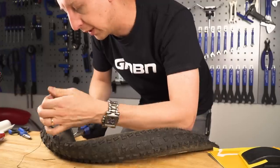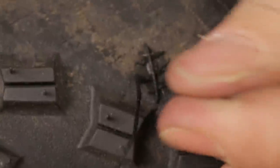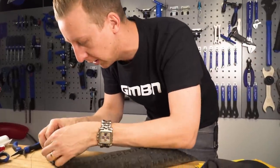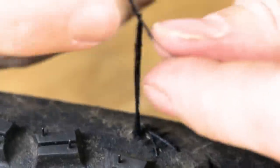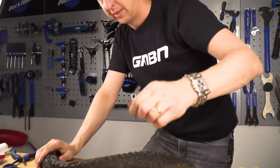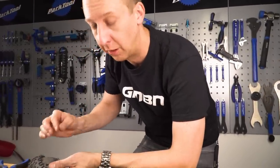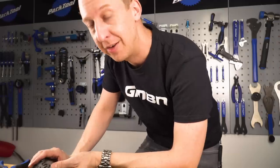I'm going to cover the stitches externally in another step later on just to make sure they don't come undone and the stitches themselves won't rot. That's a tyre knot in there and I'm happy that it's going to hold despite not looking like the best work. If there are any surgeons out there you'll probably be disgusted with this, but it's a tyre so I don't really care. So that is the tyre stitched from the outside - the purpose being to stop that slash growing anymore. It's no longer tubeless compatible but we're going to remedy that from the inside now.